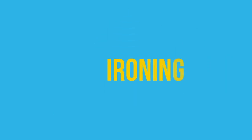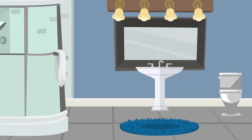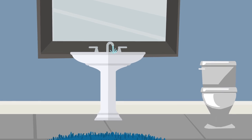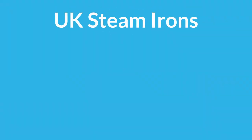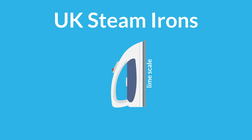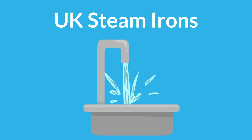Ironing with water softeners or filtered water. The wear and tear that an iron will face from the hardened water of Southeast England can be greatly reduced with the introduction of a water softener. Nevertheless, the advice from UK Steam Irons is that if you have a water softener in your home, it is best not to fill your iron with this water alone. Whilst it will help remove limescale, other materials the water contains can eventually lead to clogging and a return to unpleasant spitting and staining. Their advice is that you should only use water from the drinking water tap, which may be part of a full water filter system.